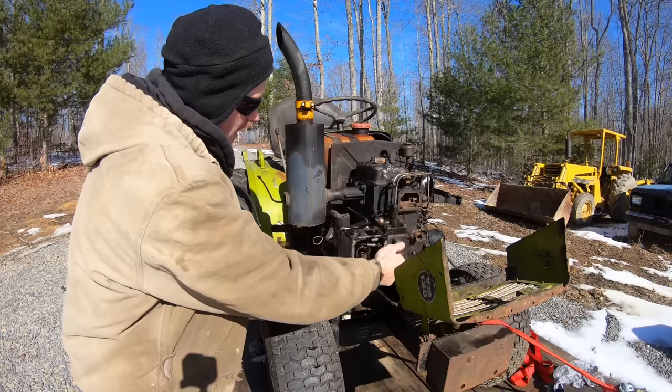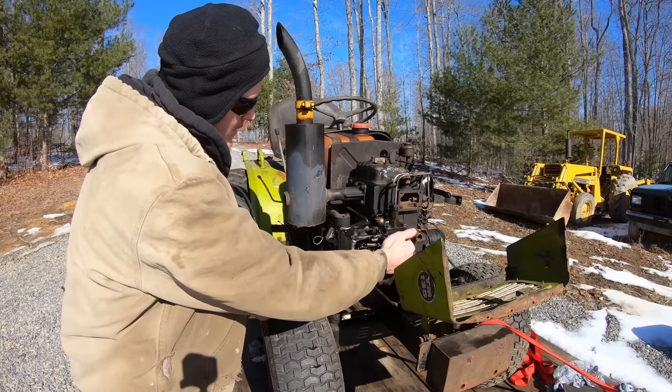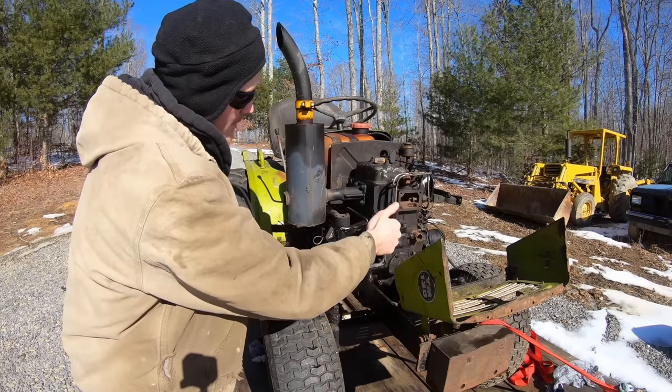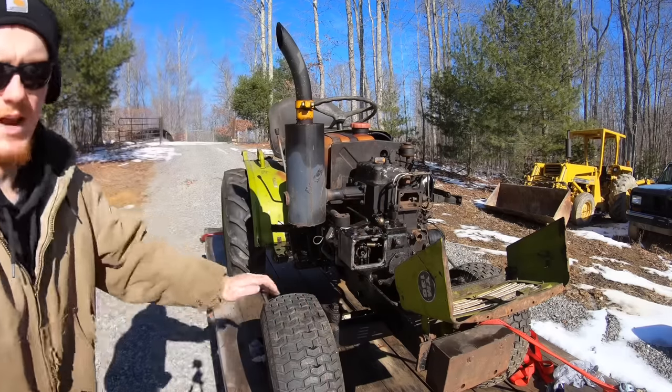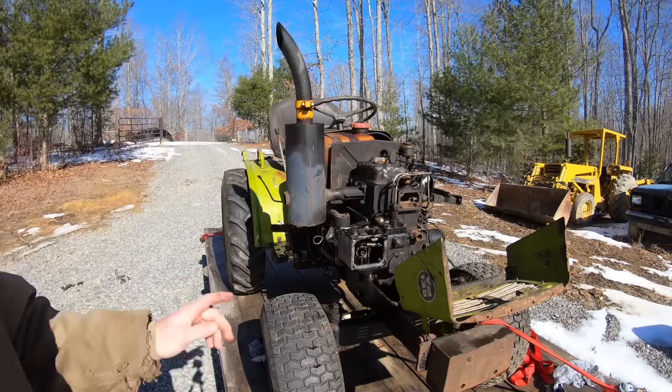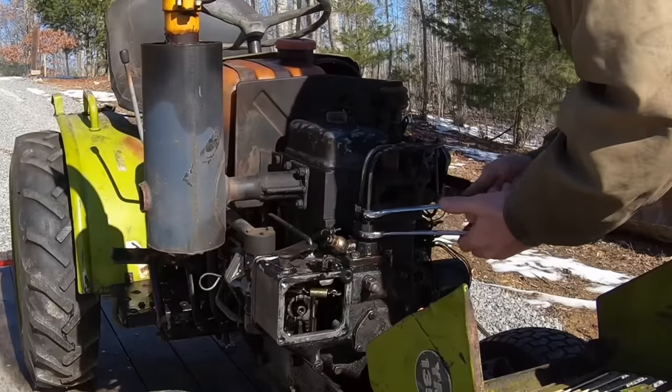The injector actually fires off the camshaft on them lobes. I think it's something in the pump. So, being that I have another pump down here, let me go get it and we'll swap them out and see if that makes a difference. Pop this guy off of here.